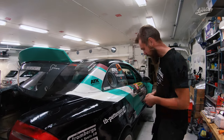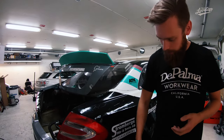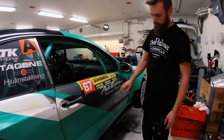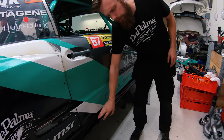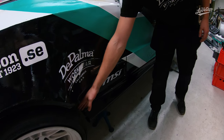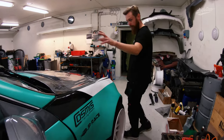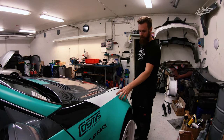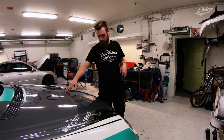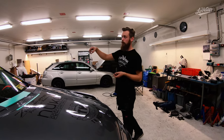As the body goes now, we have cut the car off here — the complete rear end, the bumper, the fenders — we have plastic doors of the same weight of course. We have a C63 CLK side skirt that has been widened a bit to meet the gap because the car is so wide. In the front it's fiberglass as well as everything else — also much wider and higher in the wheel wells. The complete car is built in fiberglass: the hood, fenders, bumpers, and doors. The only things still stock are the roof, the A-pillar, and the C-pillar.